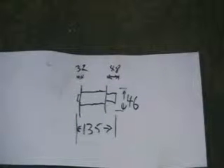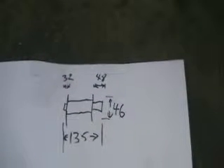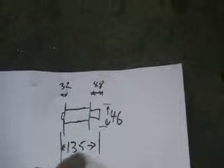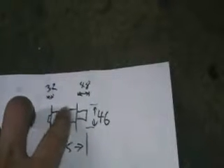So I've done a rough sketch with all the measurements we need to take. To get the actual measurements we're going to put into the calculator, we're going to divide the hole distance by two and then subtract this distance, and that will give us the distance from the flange to the centre. The other thing we need is the rim's ERD — this will be on the manufacturer's website, or if you're using Spoke Calc Express like me, you can download them; they'll all be on that program.